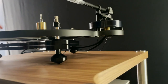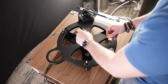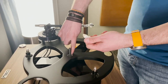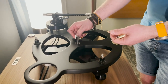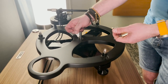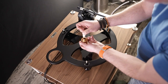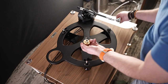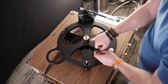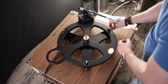We're nearly there — the tone arm is fitted, the base is level and in position. We're now ready to fit the platter. Lift the bearing body up; we supply a vial of oil. The correct amount is roughly 2mm in the bottom of the well — you don't need to be absolutely exact. Fill the well at the bottom with roughly 2mm of oil, put some on the top of the spindle, let some dribble down the side, and a couple of drops in the body of the bearing. Put it in position and give it a spin to make sure it's nice and free. If you've overfilled, oil will spin up the top — just mop it up with some kitchen paper.